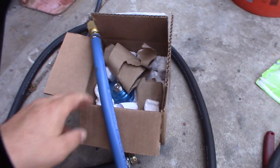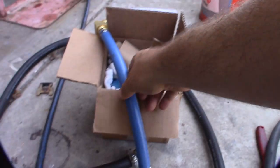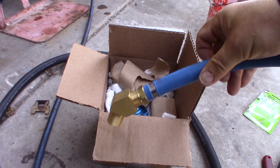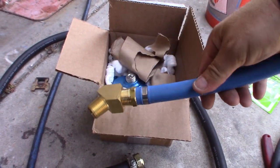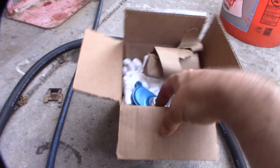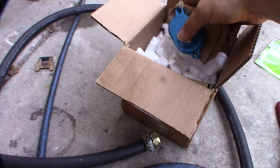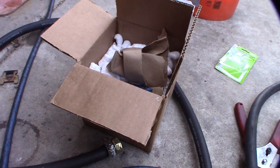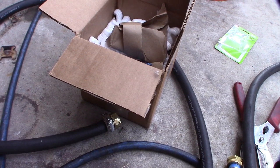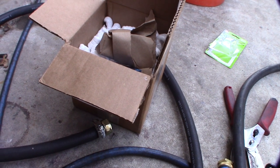I bought a back flush kit a few months ago for my Power Stroke 6.0L truck — it was about $85 on eBay, normally around $125. I'll try to put the eBay link in the description. It came with a cool anodized aluminum piece. My delta temps are actually going up to about 16 on the highway, and I've had this truck for five years — it's been creeping up about a degree every year.